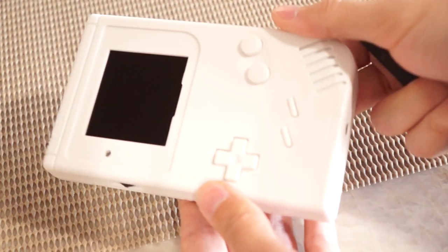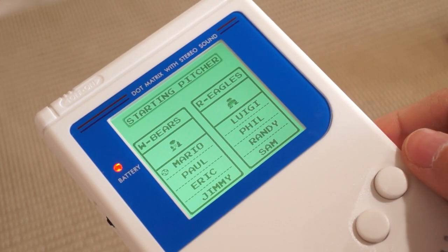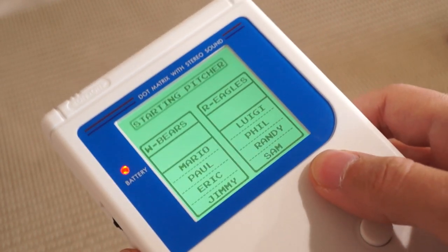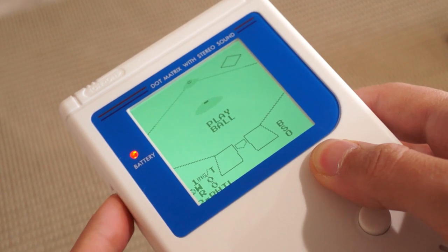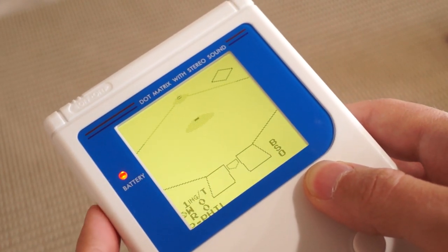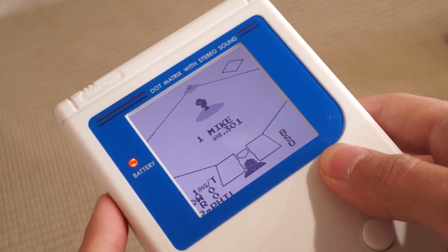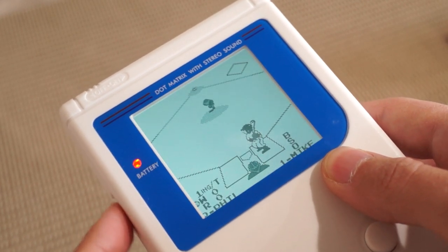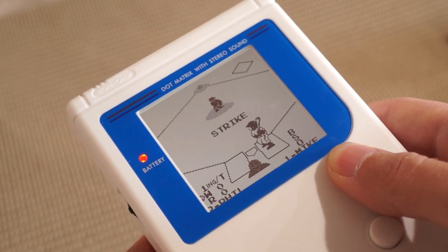Install some fresh AA batteries or a clean juice battery mod and you're all set. We'll show you a few cool things with this kit. So we've booted up the game — baseball. Toggling the control wheel up and down will adjust the brightness. Pressing the control wheel in once will switch to color palette changing mode, and toggling the wheel up and down in this mode will change the color displayed. Long pressing it for at least five seconds will let you change the pixel modes.